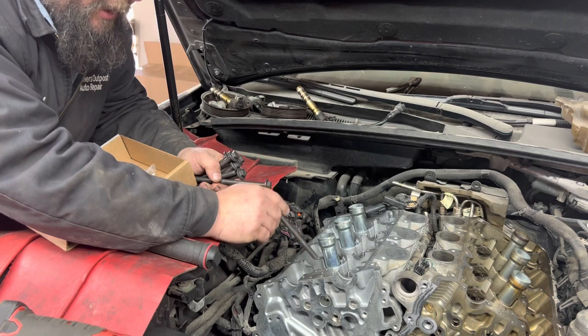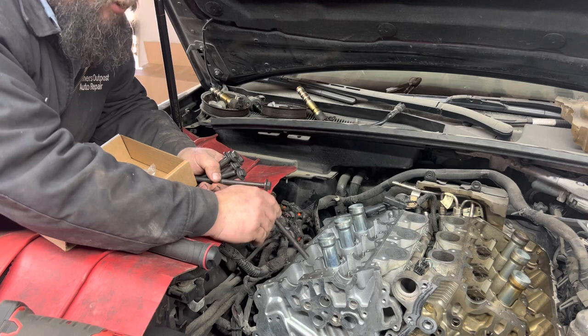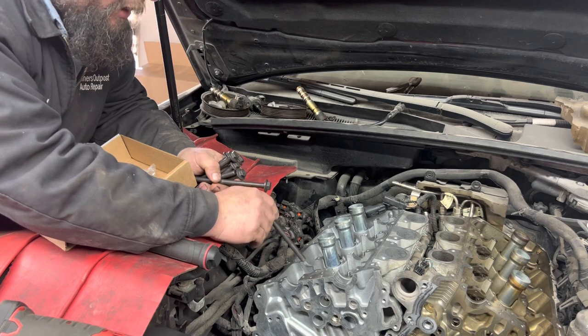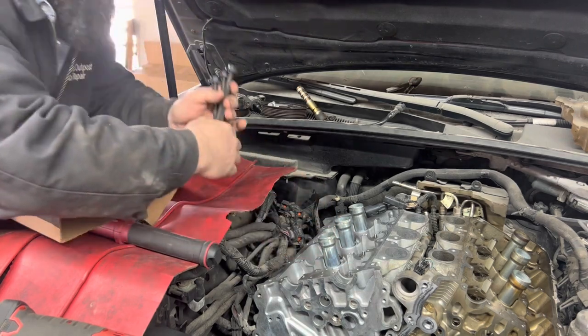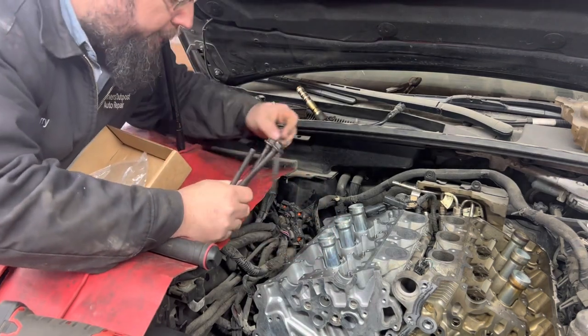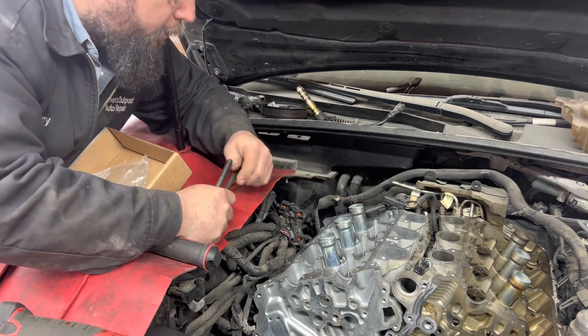There's been debate on whether to put never-seize or oil on them — you used to put oil on bolts to get an even torque, but they figured out don't do that anymore. Install them dry. Before I put the head on, I blew the holes out and made sure I didn't have any foreign debris or liquid inside the holes, because that'll cause them to hydro-lock and that'll make for a bad day. These are all the same length, so we don't have to worry about which one goes where.